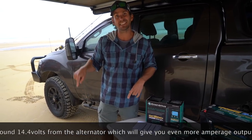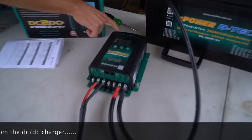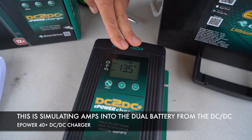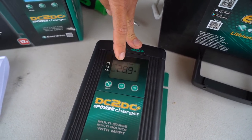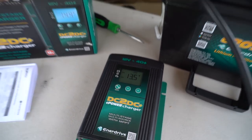At the moment, that's the 6mm twin-core cable coming in. At idle, if you have a look here on the charger, it's only getting 23.4 amps. If you ramp that up — Dave's going to idle up — we're getting about 28.9 amps. And that's out of 6mm cable.